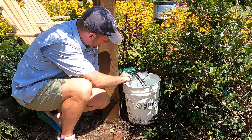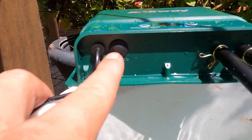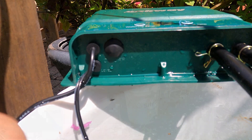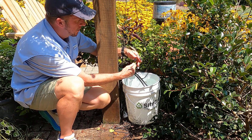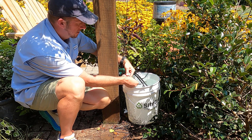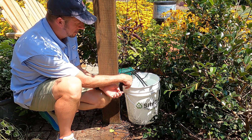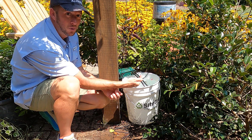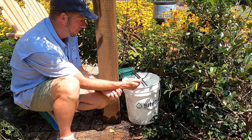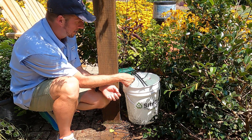So how did we get to this point? First, you have to turn on the pump — there's an on/off button on the bottom. Make sure the two little sensor wires that come off the pump are inserted properly. That sensor tells the pump there's no water left in the bucket; you don't want to run the pump dry or you'll burn it out. Once the wires are back in water, the pump kicks back on.